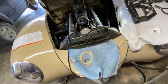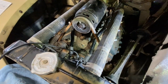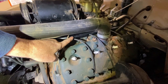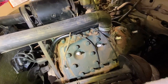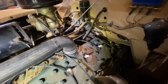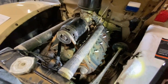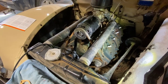In putting an electronic ignition on this car, there are a couple of key things that, if you haven't done this before, would be some helpful tips. On this flathead engine, along with others of the era, they may have these metal tubes — and these are what your spark plug wires come through. On this side are the 5, 6, 7, and 8 plugs. Getting those spark plug wires through that tube is a bit of a challenge, and the way to make it easier is to use a little bit of Liquid Wrench or WD-40 on the spark plug wire as you push it through.